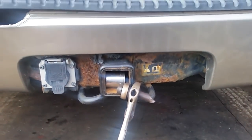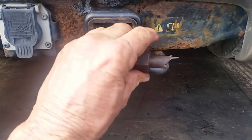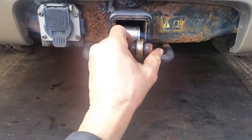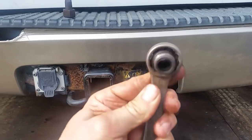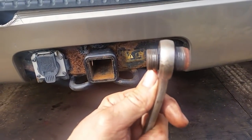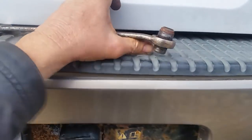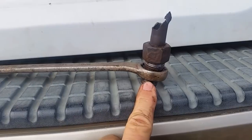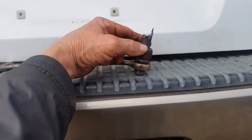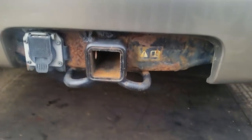It's still a little hard to turn. Let's see if I can get this off now — this is the only way I can get this off. You notice the whole thing is turning, and this is the problem you get into. It's almost impossible to get these EGR tubes off. And here is our nipple — this piece here is about $10 or $15 when you go to buy it. So this will save a little money. When you're taking these off, if you can get a wrench on here to hold this, and when you're trying to take this off at the manifold, sometimes you can get lucky and get this off. But most of the time when you're trying to turn this, the whole thing will turn and there's not much you can do. The key is to get a wrench on there that's really snug. If you have a trailer hitch on the back of your vehicle, use it as a vise sometimes or a clamp to help you out.